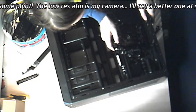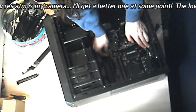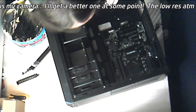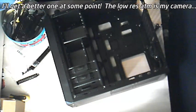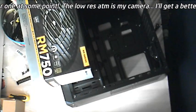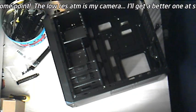The extra 3 are what looks to be in case you have a shorter board like I do. But everything sits nice and neat atop everything there, look. Looks like we're all good for actually seating the board in, so yeah. I'll do that in a minute, because I also need to do the power supply and all sorts of other bits and bats as well, but for now, I'm going to throw the power supply in and sling the 8-pin EPS power connector in just to get that out of the way.